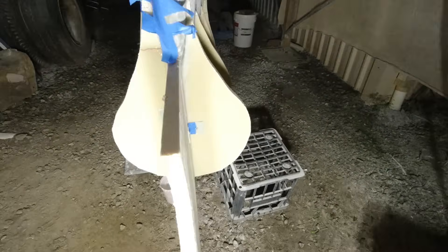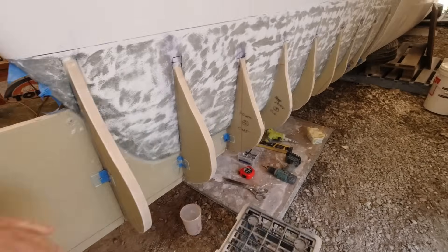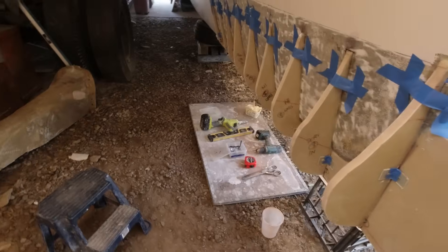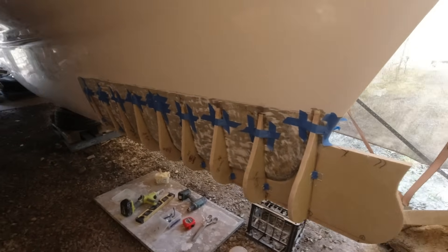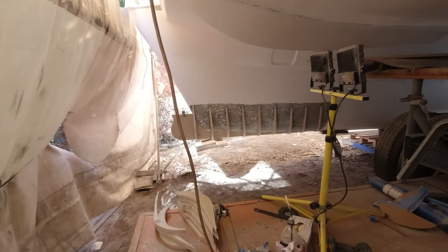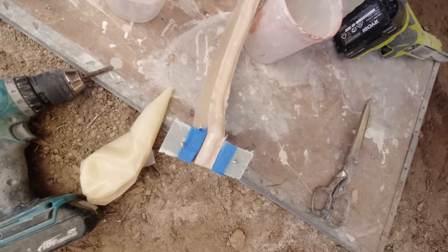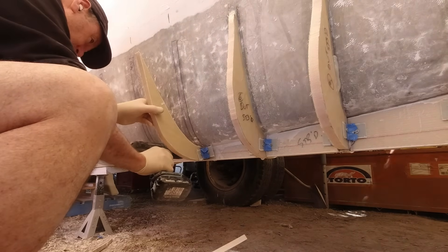That's the fourth side done — complete. Last night I put these on, so these are ready to pull off. I'll get my screwdriver and pull all the cleats off. Don't worry about those holes where the screws are — they're going to be filled with epoxy and foam. We're going to keep it as light as possible. This is all going to be filled with H80 foam and then laminated over the top. I've only got a certain amount of cleats and I knocked up around nine o'clock last night. I'm going to go out and do the other side, and then the whole thing will be ready to start infilling with foam. I'm halfway through going on the starboard outer hull shapes and these are almost done.